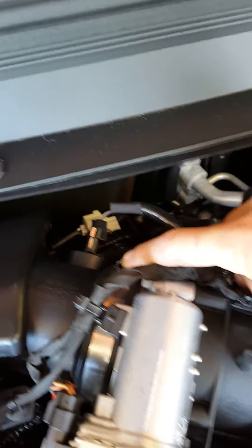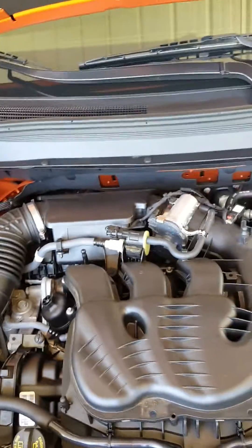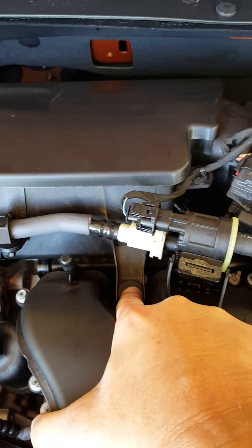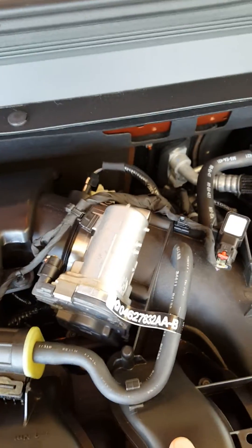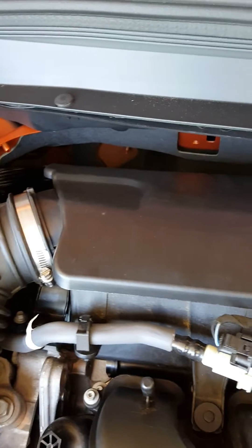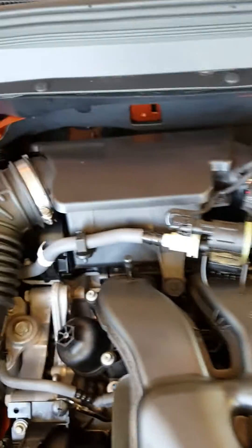Then your air plenum here has a plug in the back and the front — just a plug, just like your engine cover. This here looks like a bolt but it's not; it's just a rubber grommet type plug. This bracket slides under — pull on the back and that'll pop off, you'll feel it — then slide it off and out of your way. At that point you will be able to see your three rear plug coils. All they are is a coil with one 10 millimeter bolt and the extension which goes down in the hole to change your plug — fairly normal, just like others.